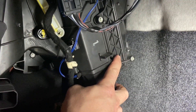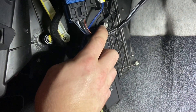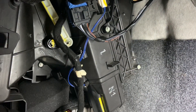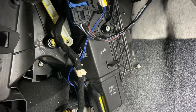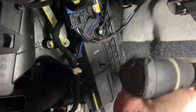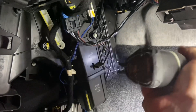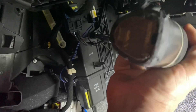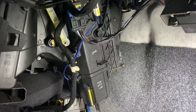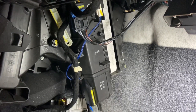This is the cover where the cabin air filter is located. You'll see it's secured with two bolts — one here and one here — and it requires a five-millimeter socket to remove them. If you have an impact it makes it a lot easier because of how you have to get in here. Remove both bolts and the cover should just pop off — set it aside.